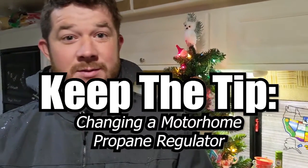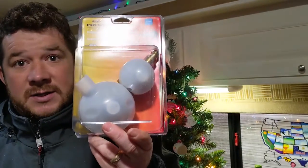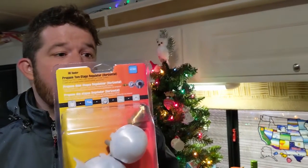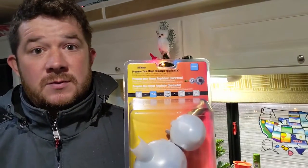Hello, and this is going to be another tip video — a how-to. It's currently raining and snowing outside where we're at. Over the last few days, our propane hot water heater has been going out and our propane regulator hasn't been working exactly like it's supposed to. I'm assuming that means it's starting to go bad. After a number of years they do need to be replaced. Most RV motorhome propane regulators are two-stage regulators, which I just picked up from Tractor Supply for somewhere around 30 to 40 bucks.